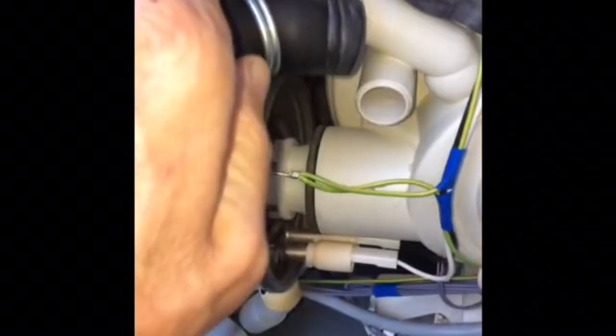We're using a little electrical cleaner to clean these contacts on the heater pressure switch — they were looking slightly corroded — to see if that could help. We get the modular connections put back in and we're going to put the heater pressure switch back into position. If you have a new one, this is the procedure you would use to put the heater pressure switch back in. It does have those two black rubber grommets — you want to make sure those are in position.